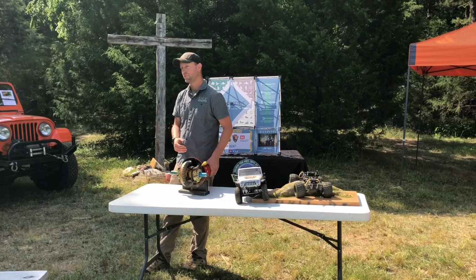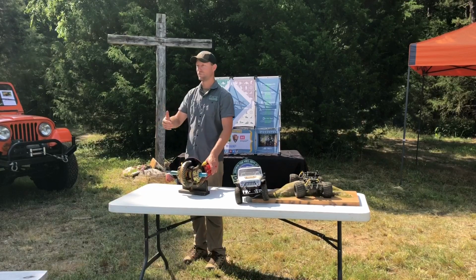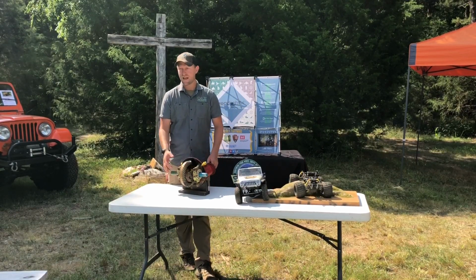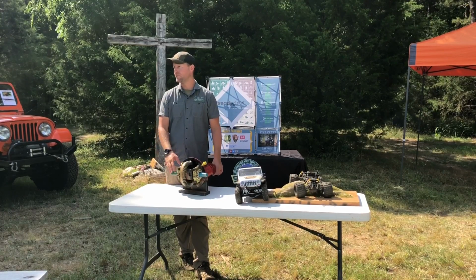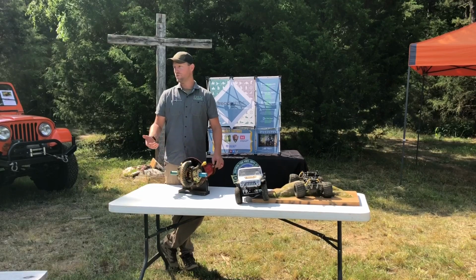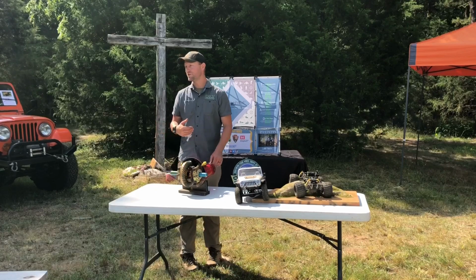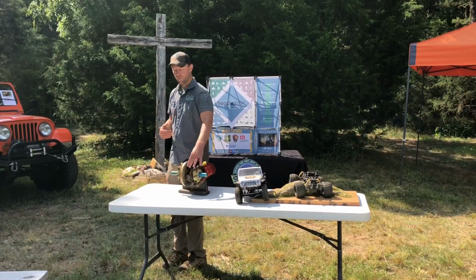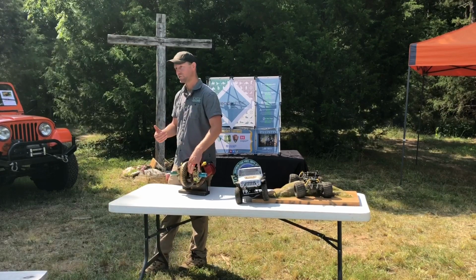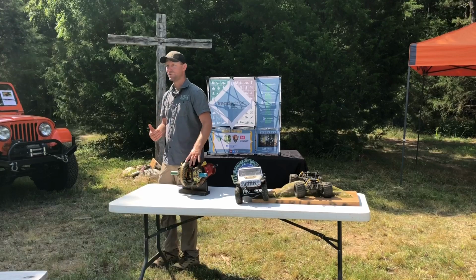So do we really have 4-wheel drive vehicles? No, they're 2-wheel drive vehicles. One tire in the front and one tire in the rear will spin. So how do we overcome this when driving off-road? Okay, we can have lockers, we can have limited slips, but those are mechanical things our vehicle does for us. What can we do as a driver? So we have a way of becoming our own locker or traction control for the vehicle, and it's called 2-foot driving. So how do we 2-foot drive?